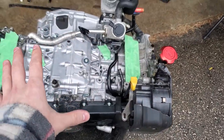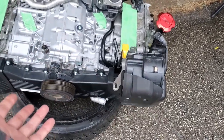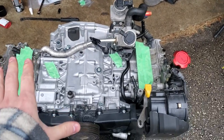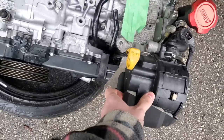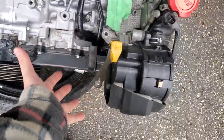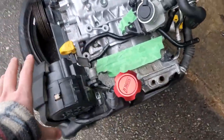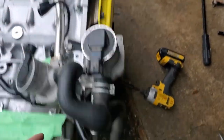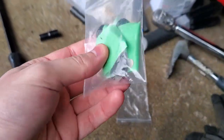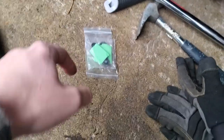You don't need it. All this is emissions-based, so if your state or province doesn't have emissions you could do this — if it does, maybe don't do this. I also just installed it so it's kind of in, not fully in the car obviously. Normally you have your AC unit right here that it mounts to. Basically, all you see is this pump right here, the hosing, these two solenoids, and all the silver hoses like this one right here. It's getting replaced by these two little block-off plates. I just have green tape around them so I don't lose the gaskets, but those are going to be going on the car.